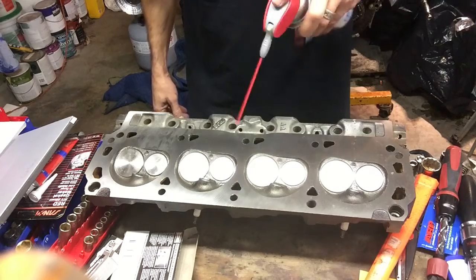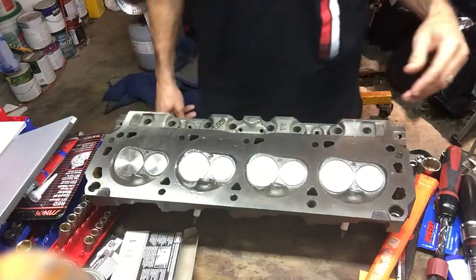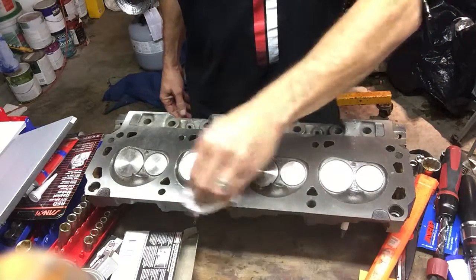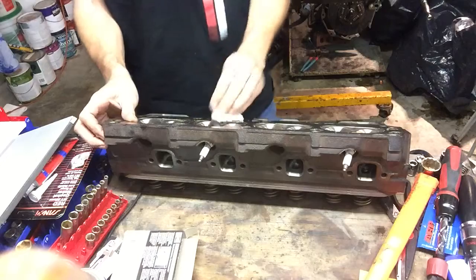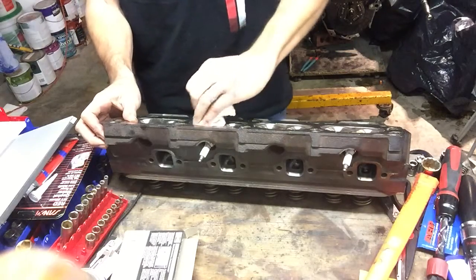Spray a little oil there. It is a very important term relative to fuel choice. You actually want to make your fuel choice not off of your static compression ratio, but off of your dynamic compression ratio. That's what matters in that case. And so we'll see as we go.